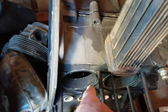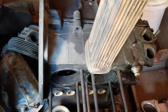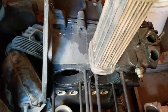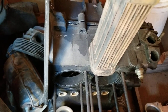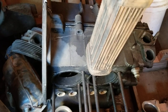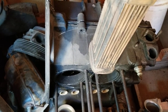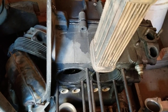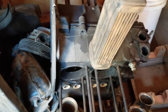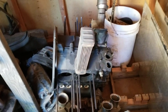When you go too large, you're gonna run into problems there. And also when you start going to like an 82, or something like that, you have to cut up a lot more of your case inside, or larger than that especially. Definitely go to aluminum case, especially; 82 is even pushing it. I would like to see a 78 in a stock case, unless you just got cases laying around, you don't care if it doesn't last that long. But that's not really the point of this video.